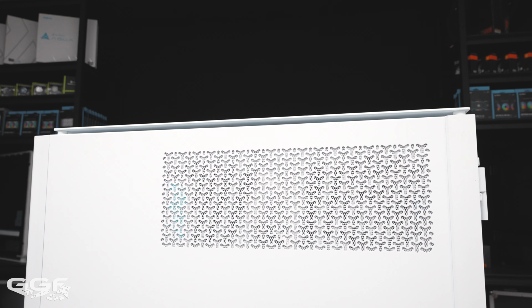And another thing I came across, I did spend a few hours trying to work out. Now, you also may see on the Corsair product images, they're running two of their XD5 Elite LCD pump res combos, like I've done here, but iCUE only supports one of these pump res combos. When I say one, it supports it all fully. It just only supports one LCD. When the second one is running, or you have two running, the second screen just flickers like mad. So I reached out to them, and yes, they know that's an issue. They're gonna look into it, and hopefully we can fix that, because I was like, hey, sweet, I could have CPU temps, everything related to CPU on one, everything related to GPU on the other, but unfortunately I couldn't.